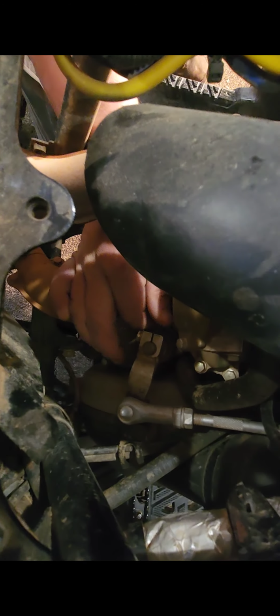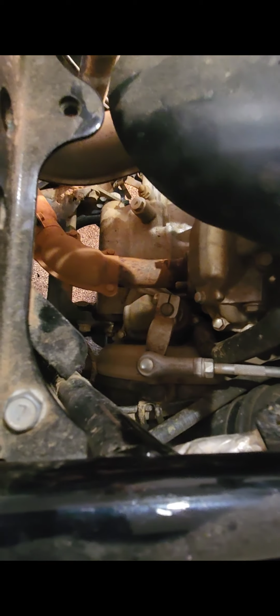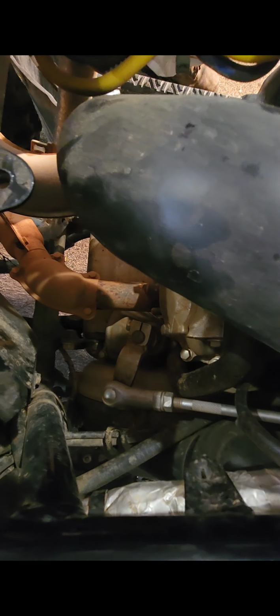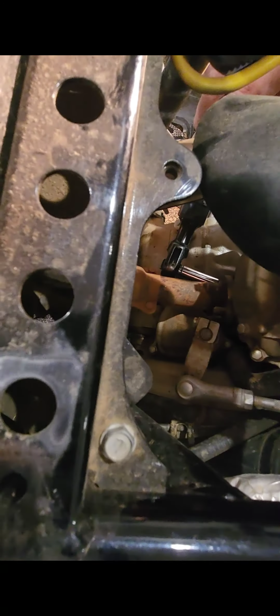Taking the rear head bolts off now, they're a 12 and they are on very, very light. When you take these off or put them back on, the most is 25 torque spec. So it's important to know, when you put it back on, as long as you're around 25, that's important, but you definitely don't want to do it too much to where it comes off.